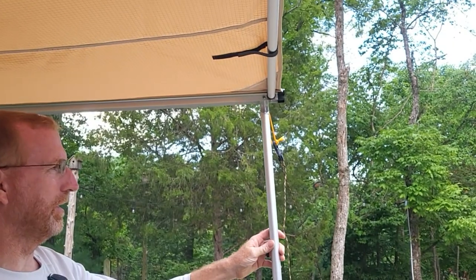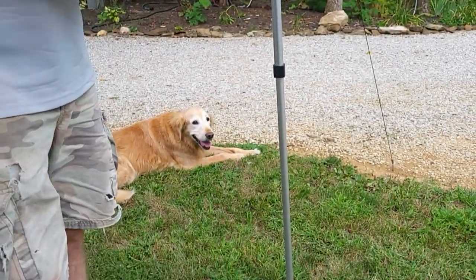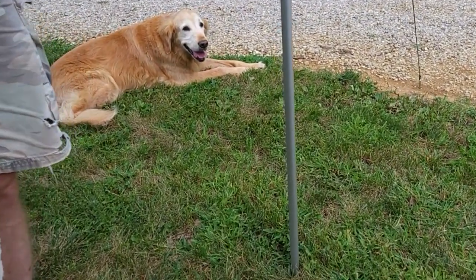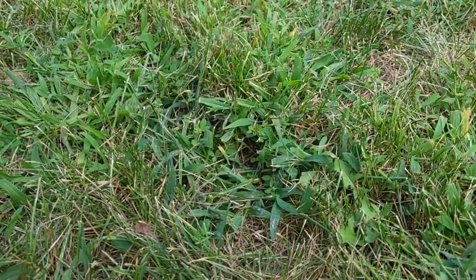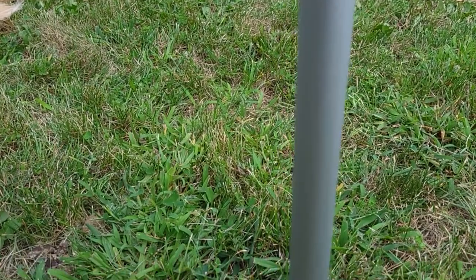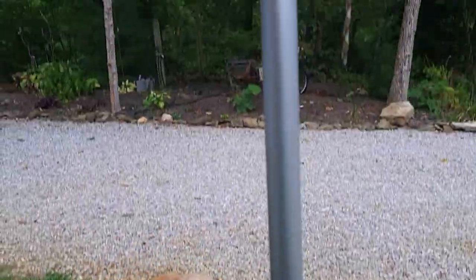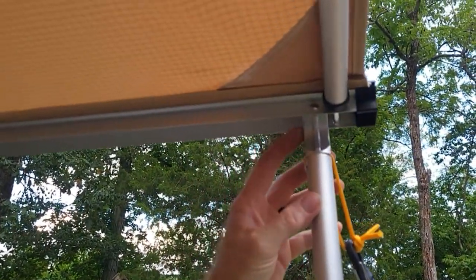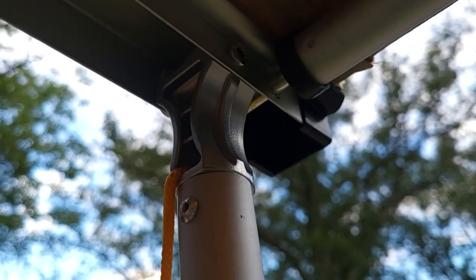Out at the outer end, the leg looks very similar to the ARB — they twist and pull out the same way. The bottoms on the Napa legs are flat, whereas the ARB has a pin that sticks out the bottom so it can stick into the ground a little easier. The Napa is just a smooth plastic cap on the bottom. Up at the top, the metal fastener fitting versus the ARB's nylon fitting. And then the longer pin on the Napa goes completely through the outer track, making it very stiff — whereas the ARB pin does not go all the way through.